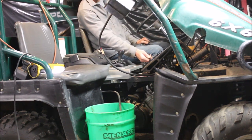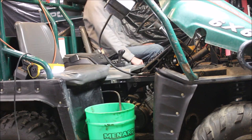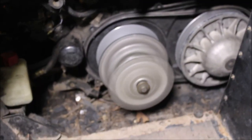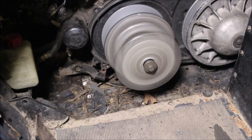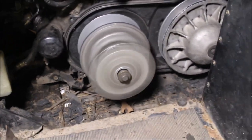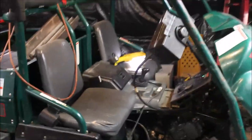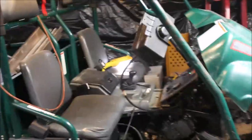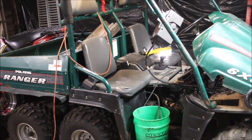So I got to do some minor carb adjustments as it comes off choke. The chipmunk chewed up the belt, wrapped it on the clutch, and it wasn't allowing the engine to spin. Now I just got to buy a new belt, put this thing back together, put my air box on, and tweak the carb. She's running out of gas. So yeah, one more easy fix - just tweak the carb, get a new belt, and this bad boy will be ready to go.